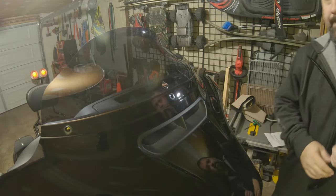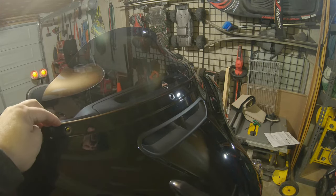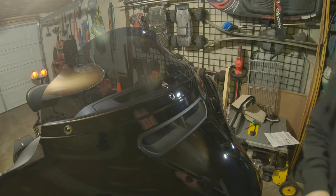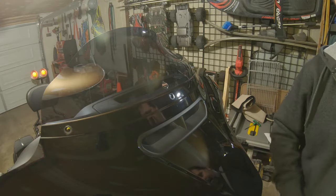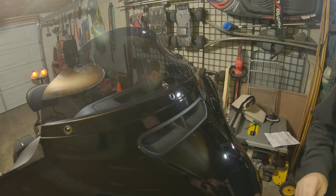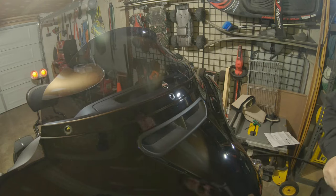Fun fact — according to the directions, they want you to put a screw through this, then place it on the fairing, and put the gasket or isolator — that I thought went on the screw — directly behind the fairing in front of the windshield. I'm sure there's a rhyme or a reason; the directions don't tell you why. But what I just learned is if you're not exceedingly careful, and you're a dumbass like I am, you drop that gasket behind the fairing. Which then means you've got to partially remove your fairing to get to this isolator or grommet or whatever it is. Now that I've fished that out, we're going to do it the way the written directions say, which is slightly different than what the picture shows.